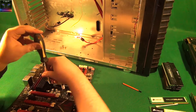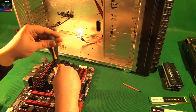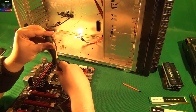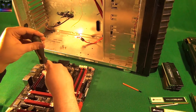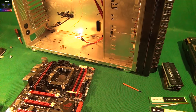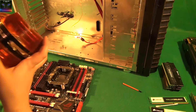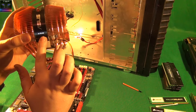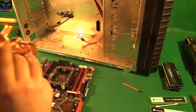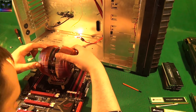Let's try to put it in here nevertheless — if these plastic bits were metal it would actually be good. It's touching the motherboard a little but that's okay — not too much. Always tighten it diagonally like a car wheel so you don't twist it. Not too tight because the brackets are plastic. Now let's put the cooler on. I applied Liquid Ultra thermal paste — check that video if you want to know how. Airflow means it has to go this way.